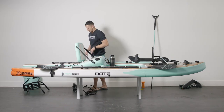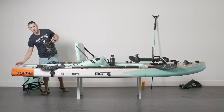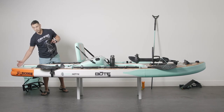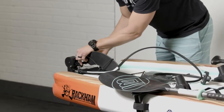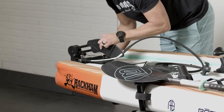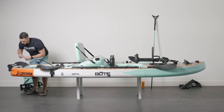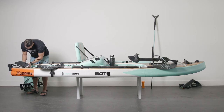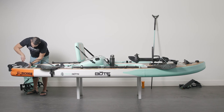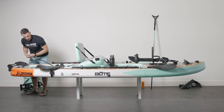In order to use the pedal drive, how are you going to steer it? That's why included in the kit is the rudder kit. Installing this — you have your mount back here. This is also compatible with PowerPro Micros, but you can also use it with the rudder kit. Match it up, put this going forward. I always put the little back handle inside of it, match up, and drop the screws in. Do not use a drill — make sure you use a screwdriver. You don't need it and you'll definitely over-tighten. Simple, easy.